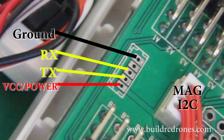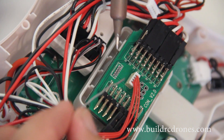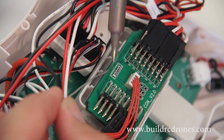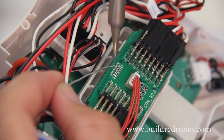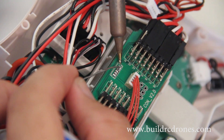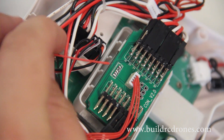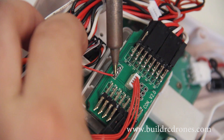Now it goes in this order, and it needs to be this order. The thing you need to remember is not all of these telemetry units are exactly the same, so the color coordination of the wires may not match up. This telemetry unit I'm using in this video I do offer on my website, so if you want it to match up to the video exactly, that's the one you should pick up. There are plenty of units that will work just as well — you just have to be wary of making sure you're putting the correct wires on the correct ports.